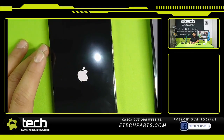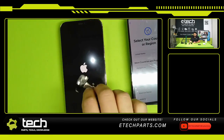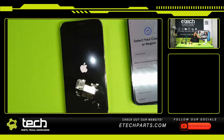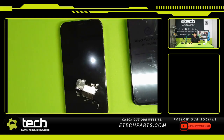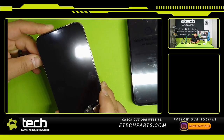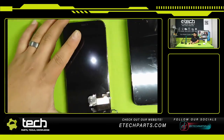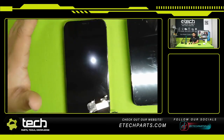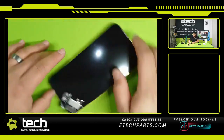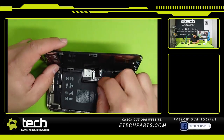It looks like my iPhone 12 Pro Max was dead, so I plugged it into a charger. My sensor flex is not connected — it's actually on the outside of the phone. Here we'll see that as soon as it boots up, or as soon as it gets past the Apple logo, the screen goes black. Now if I toggle the mute switch, I'll feel it vibrate. So the phone is in fact on — you just can't see anything on the screen.